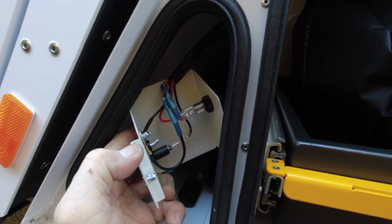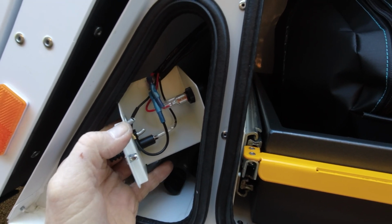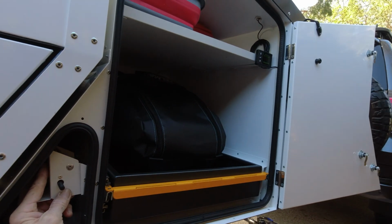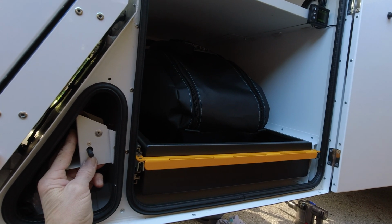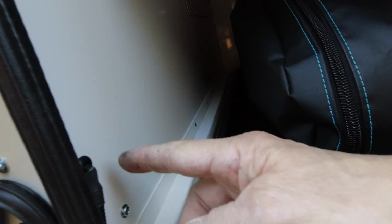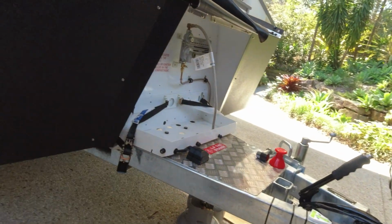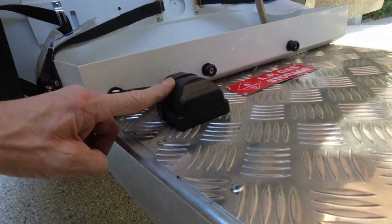So you can see we've tapped power for the Savvylevel from the constant power at the light switch in the front storage box of the TVAN. It's one of the few circuits that remains energized while we're driving. From the constant power supply behind this switch, we come through a grommet, down and around the door seal, then back and out of a grommet in the front enclosure to the Savvylevel.